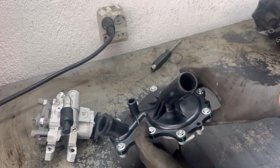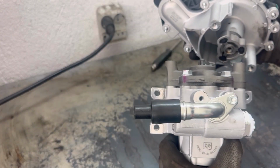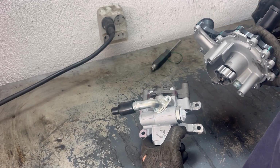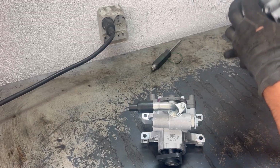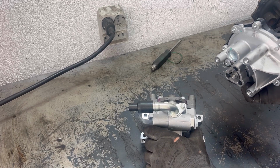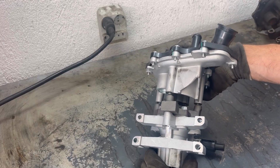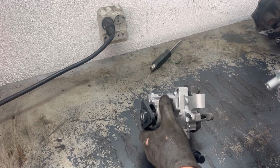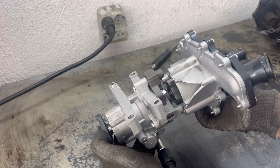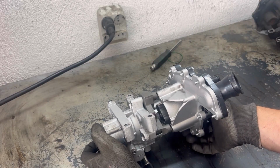Now I'm going to attach the water pump and hydraulic pump to each other. They are attached by this coupling in the middle and that bolt on the hydraulic pump. So we need to put that bolt on the threads and then start turning the shaft on the pulley. Okay, now we'll start turning the outer shaft until the bolt starts to tighten on the water pump.